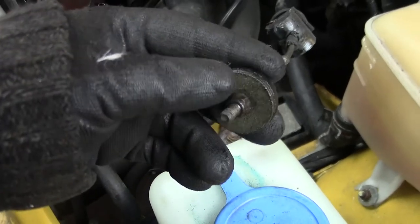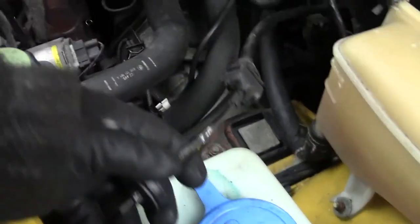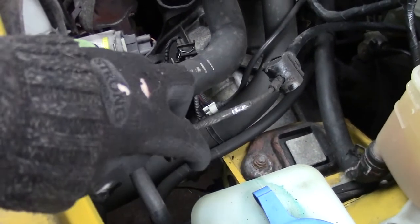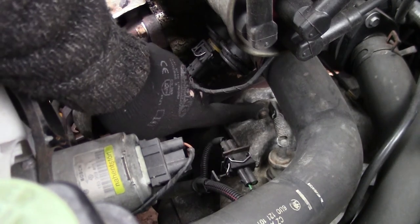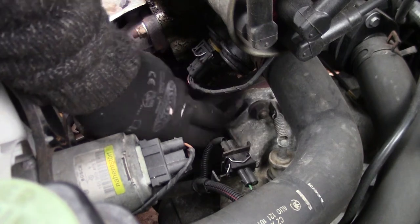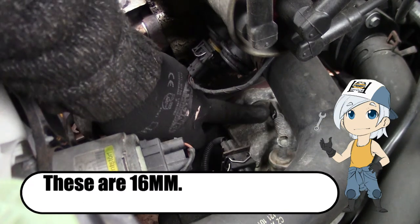As you can see, there is just a nut on the back, so just loosen it a bit. Push the lever forward and then you can unhook this. I'm sorry I couldn't get a better shot of it. Now it's time to search around the bell housing for, well, nuts and bolts. Here is one, and there is also one right here that you can't see, but start with this one.